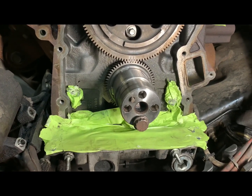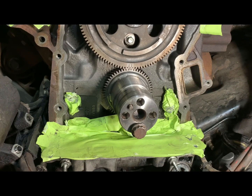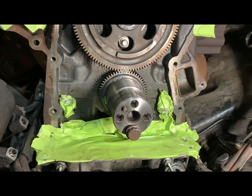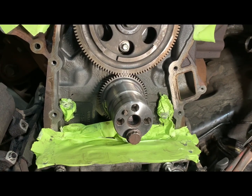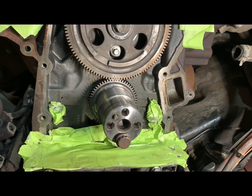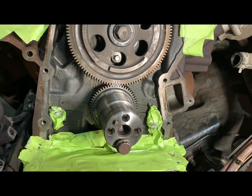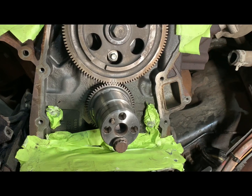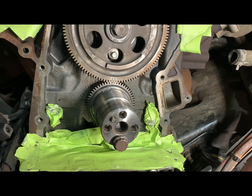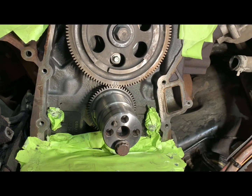As you can clearly see in that picture, it's off by quite a bit. I don't even have it at top dead center in that picture — it's a little past — but if I brought it back, you'd see that laser mark is not lining up with the bolt. Really the only way to check that is to know where top dead center is, then zero it in as accurately as possible. Using the dial indicator is probably the best way to make sure you have it dialed in as close as you can get it.